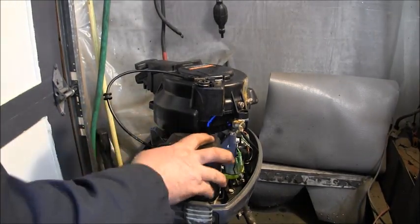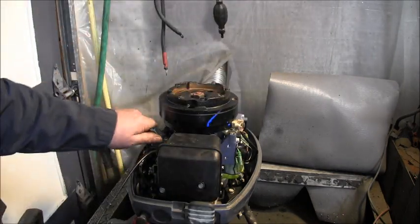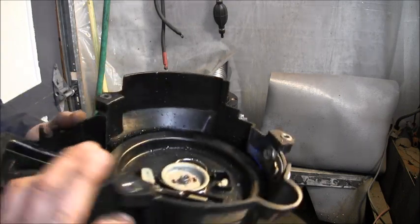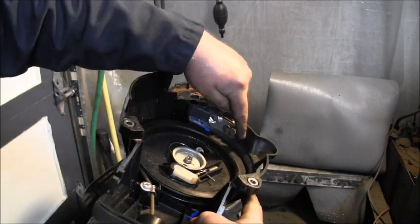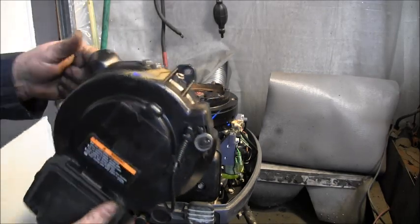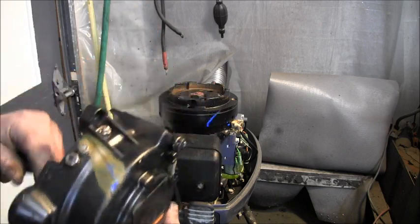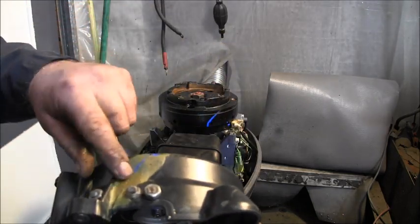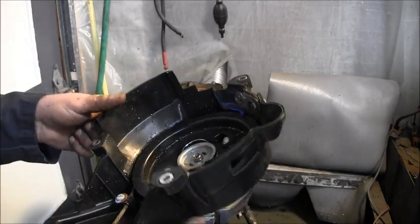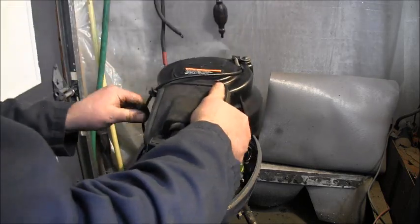Okay, I put my air silencer back on and my choke hooked up. Okay, so there's the repair we did on this bracket. That is really nice and tough. Here's what I did here. I put three bolts, three nuts, and you can see I could come right through here and I still got room to put my 10 millimeters. So there's the crack that they had gookum puckied, and now that's as solid as can be. That's a really good solid repair. And I made sure it don't hit nothing on the flywheel.